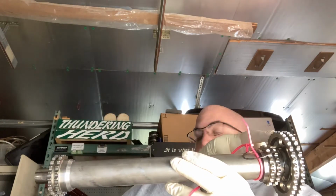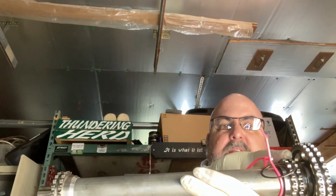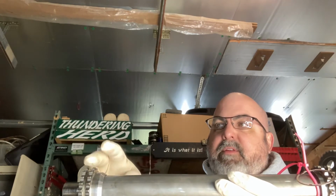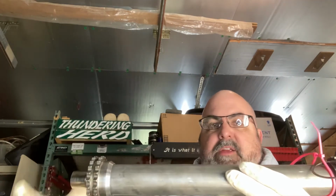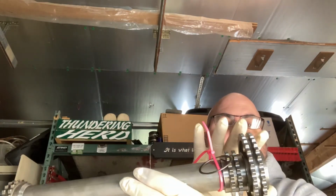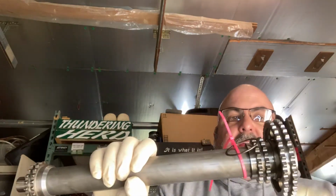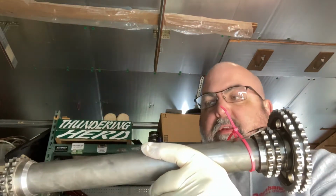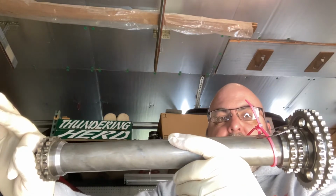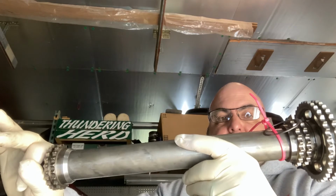This one would go to the passenger side cylinder head. This one on the opposite side would drive the driver's side cylinder head via chain, and those two chains both have tensioners, as well as the crankshaft to IMS chain. And those would be the 3 tensioners that we pulled out in the last video to take the strain off of it, because without it, you would be supported on this end, but really nothing to hold this end still.